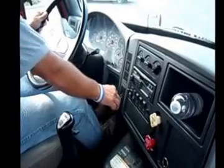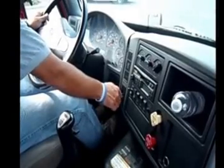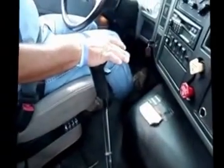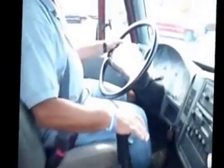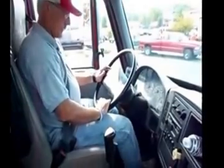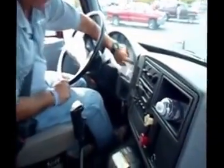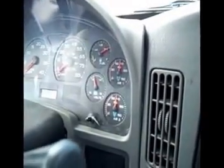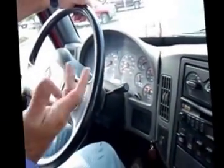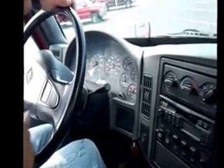At this point, shut the vehicle off. Turn the vehicle right back on, leaving it in gear. Ease up on the brake, make sure it locks into place. Step on the brake pedal. After my initial drop, my foot on the brake, I will not lose more than 4 psi in 1 minute. Okay, it's been a minute. The examiner is going to tell you go ahead.